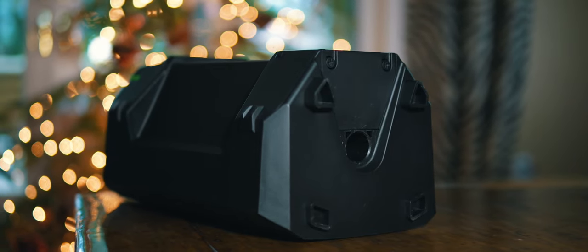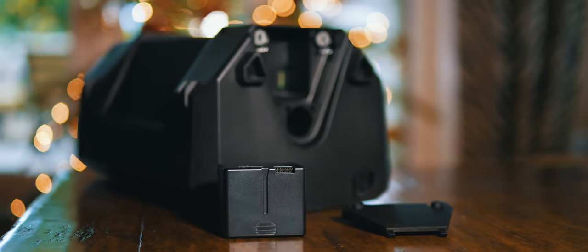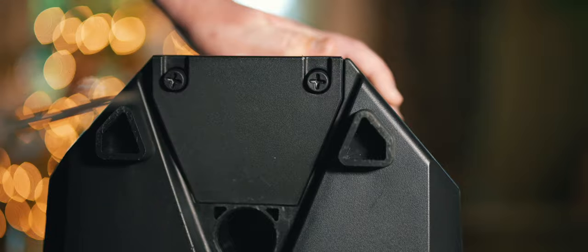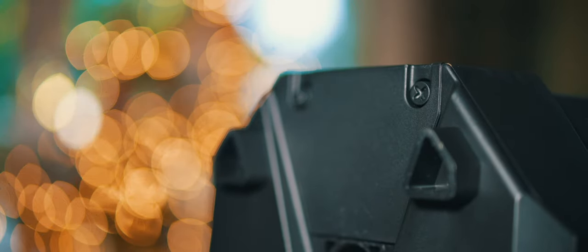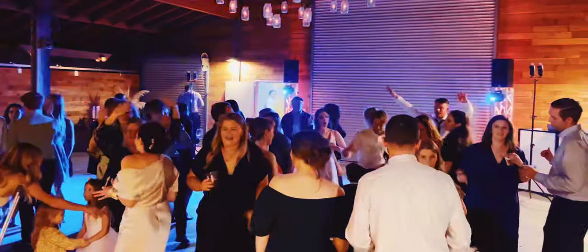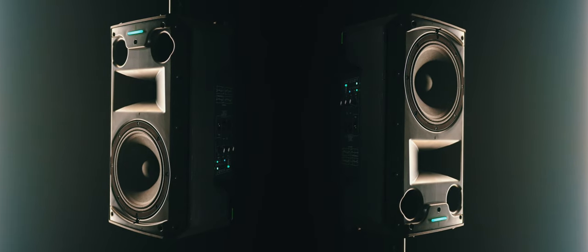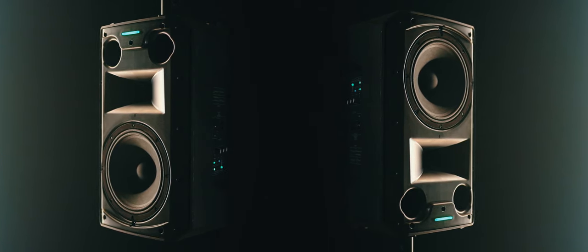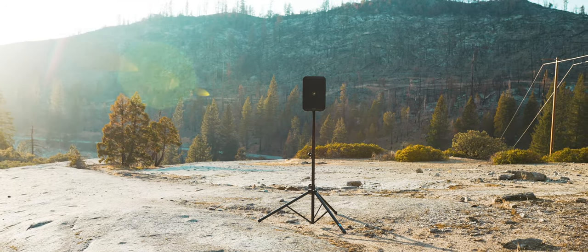The primary selling point of the Thump Go is that it's battery powered. For the duration of filming this review, including the wedding, it's all been done on a single battery charge. The swappable battery is located on the bottom side, held in by two Phillips bolts. Pulling out the battery reveals why the drivers are in an inverted configuration — the size of the battery would get in the way of the 8-inch woofer if it was on the bottom, so rather than increase the size of the entire enclosure and compromise portability, it most likely made more sense to invert the tweeter and woofer to accommodate the battery in a smaller housing. As a general rule in pro audio, you want the tweeter above the audience's head since high frequencies can't penetrate solid objects the same way low frequencies can — thankfully this speaker is so small that inverting the tweeter and woofer is such a minor change in height that it makes no legible difference in sound quality.